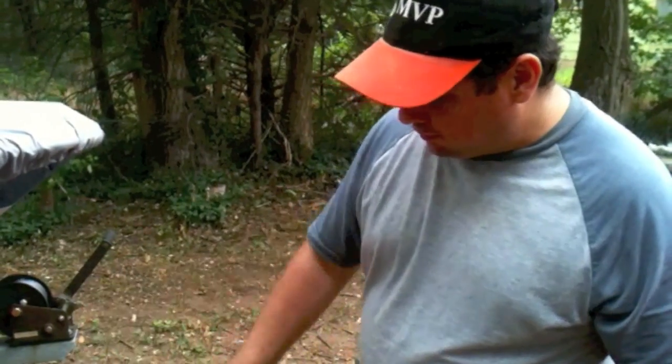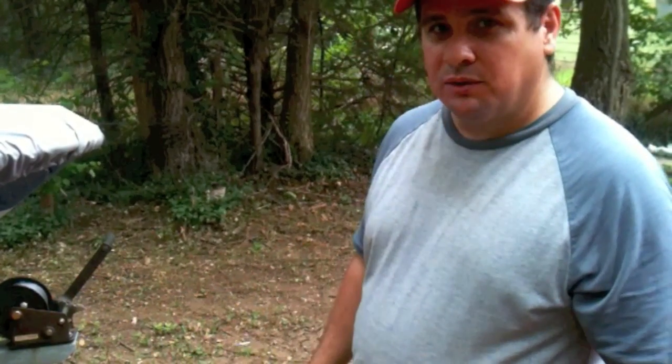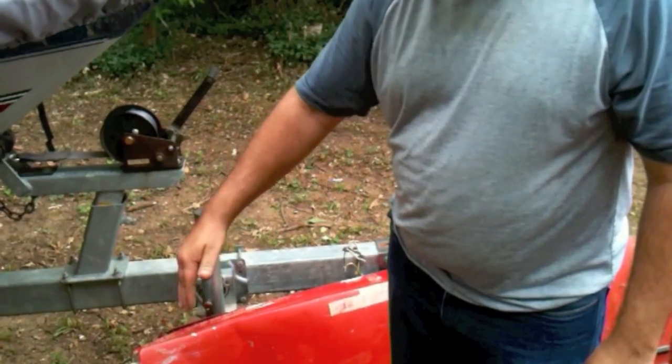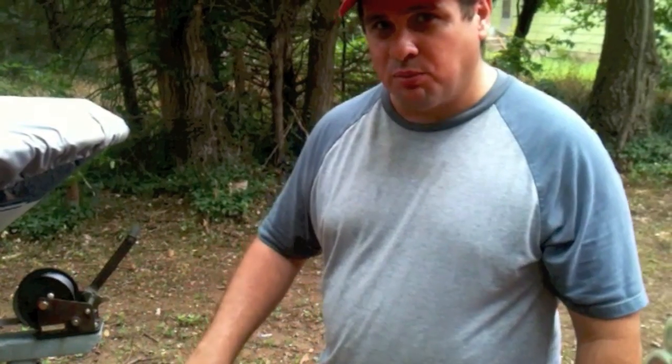Now that we have our body filler finished with a 150 grit, we're going to DA sand our surrounding edges. We're going to feather edge them with a 220 grit. And then all we'll have is the edges of 220 grit and the 150 grit sand scratches in the body filler, and that can be primed.